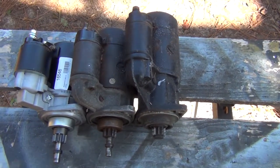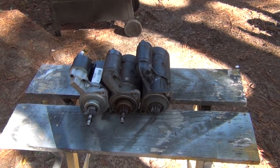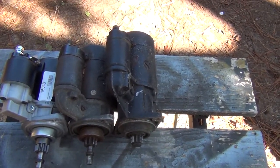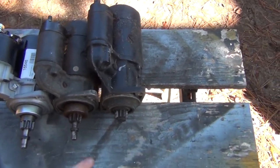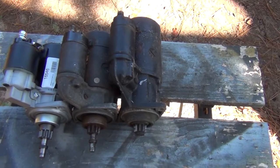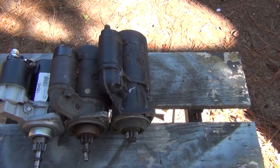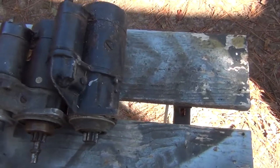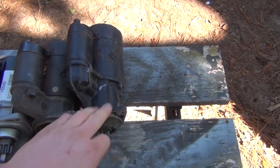There's just no place for it to plug into the transmission. So it's kind of interesting that these are the three different starters Volkswagen has used on all of their air-cooled cars. The automatic was found also in the semi-automatic transmissions, the automatic stick shift. You'll find one of these starters in there also, and that was found in the Type 1s and Type 3s. Type 2s and Type 4s had fully automatic transmissions, and they used the same starter.